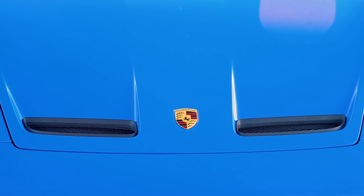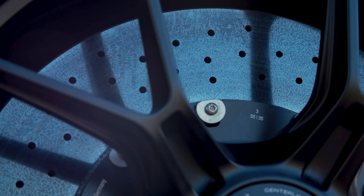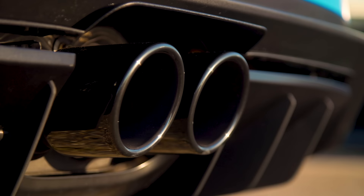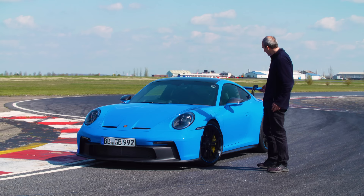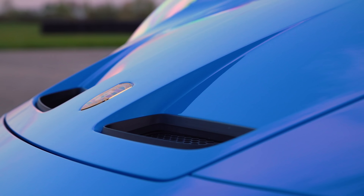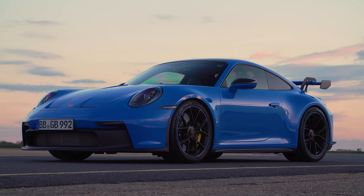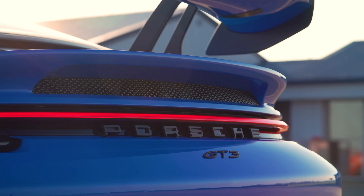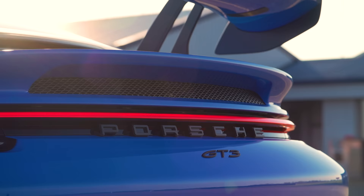They've done all sorts of things to make the car lighter — they've got rid of a load of sound deadening, it's got thinner glass, this bonnet is now made from carbon fibre reinforced plastic, and the brake discs, although bigger, are thinner. At the back, in the exhaust system, they've lost 10 kilograms without needing a full titanium system, and somewhere within the engine they've found another six kilograms. And that's before the optional stuff like PCCB ceramic brakes and this carbon fibre reinforced plastic roof.